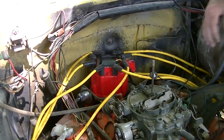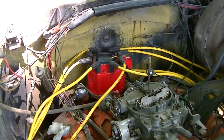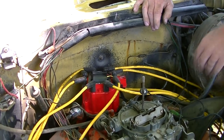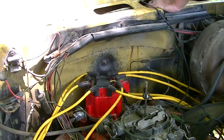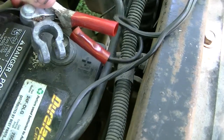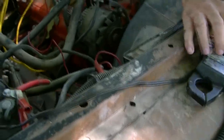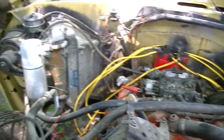Yeah, I would wiggle this and I'd lose spark. I was trying to hook the tach up. I think I'm going to adjust it by vacuum. I want to see if I've got spark right now. Could you put that positive back on? If my battery's not too low. Actually, if it does start, if you could check and see if I'm charging.